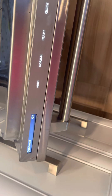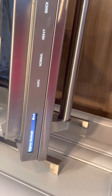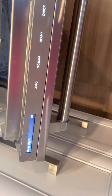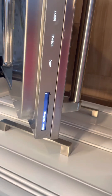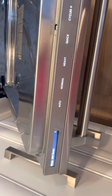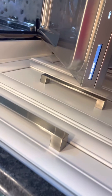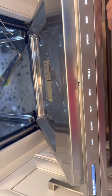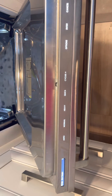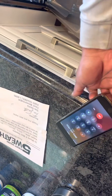Language, connect tone, level, notification, scroll rate, display, floor light, rinse aid dose — on. I just wanted to verify that it was indeed on. You can shut the dosage off, which would inhibit washing and more importantly drying. I think we're good there. Go ahead and exit at the cancel key.